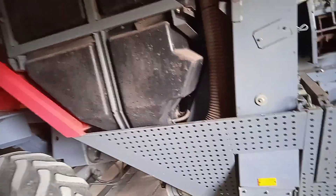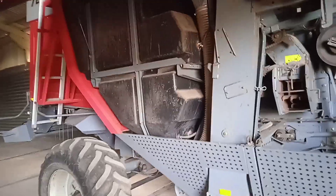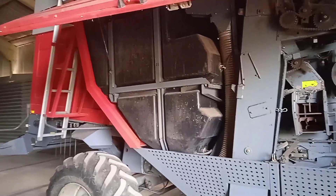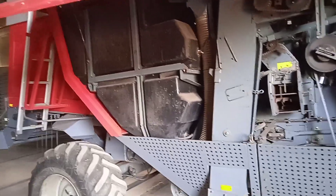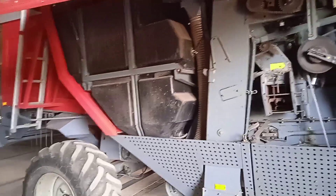That's tight on there, but we'll find out. Anyway, there's about 100 litres left in there which I've got to drain out. These pipes here are all cracking, so I feel it's probably a good idea to change them all and put new pipes on. Bit of preventative maintenance - they might never go, but it sure as hell wouldn't be much fun if they did go when you were in the middle of driving somewhere on the road.